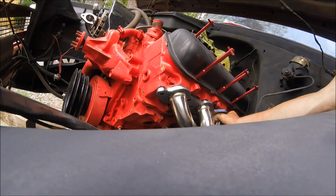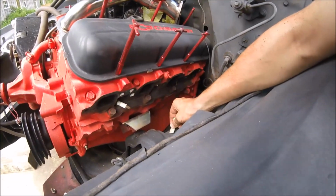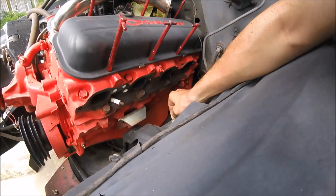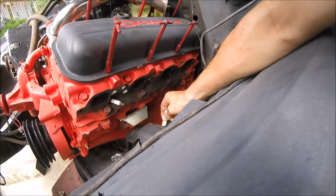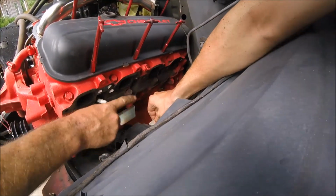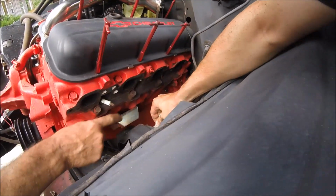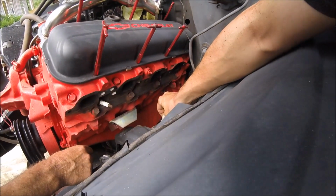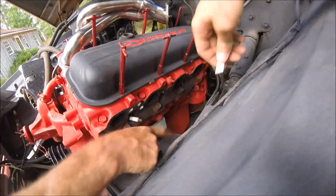I can mark it with my left hand somewhere. It's not gonna hurt if you go a little far. I mean, that frame's still plenty of frame there. Yeah, I said that there ain't gonna be no problem with the holding up. Yeah, angle that one. You see how you got it straight in? I would try to round the whole thing, because if you get a corner, it'll crack. If you get a round circle, there's no corners to crack it. There you go. That's it, the cross one. Two work bolts on, so.